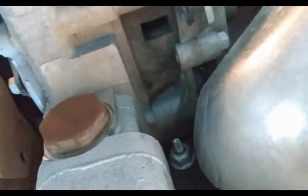It's just an eight-millimeter bolt to take out the ground on your battery while you're working — don't replace it until you're finished. Looking from the passenger side, you can see the computer, the coil pack, and everything that'll be taken off as shown in the other video. Then if you look underneath — right underneath the computer, by this side of the valve cover — that rusty-looking large bolt is the timing tensioner we're going to replace. We'll take that out very carefully because they can explode, then replace it with a new one. It sits right on the back of the head.